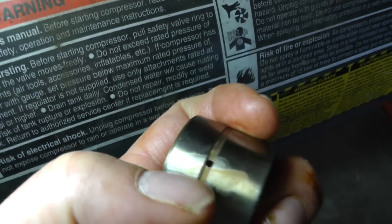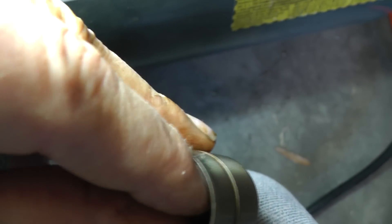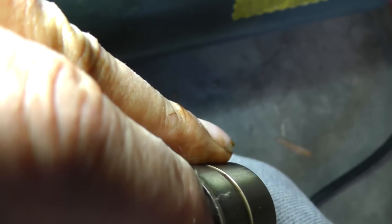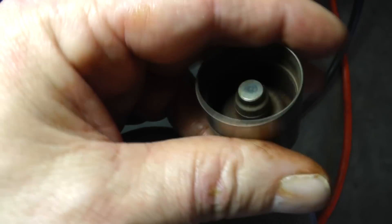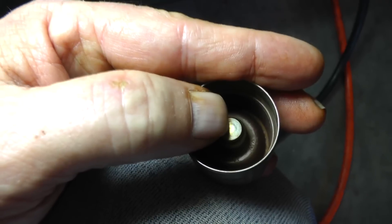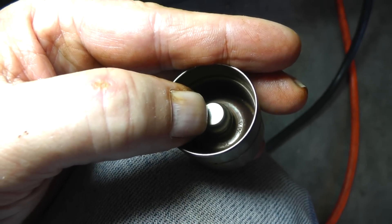The oil fill hole is right here. You should be able to take the lifter and freely turn it. I had a couple where I could feel there was some crud down in there, but after a little bit of soaking they turn pretty free now. So you may want to check that. It's always better to bleed it down a little bit and let the piston come to meet the valve stem to make the adjustment.